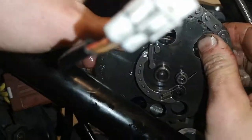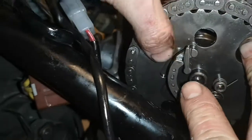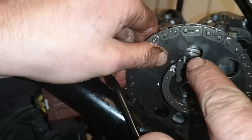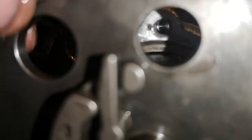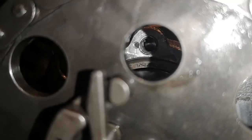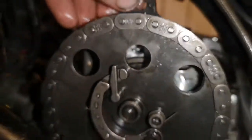So you've got your camshaft sprocket here, and this is your auto decompressor assembly here. You know you've got the camshaft in the right place because this little lever is at the top next to this hole. That hole then aligns with the hole on top there, so you can actually put your bolt through this hole and screw in there, which holds the whole camshaft in place. When this hole is perfectly aligned with that hole, you know you've got the camshaft in the correct place.